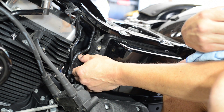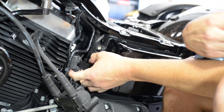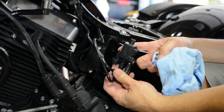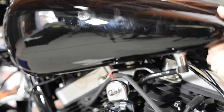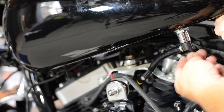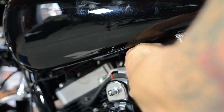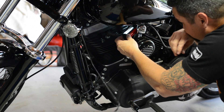If you've come this far, you've now removed all points where the vapor canister and its associated hoses attach to the bike. The last thing to do is remove the hoses and the canister itself. Make life easy on yourself — remove the bolt on the rear tank mount and loosen up the bolt on the front tank mount so that you can swivel the tank up and down and get underneath it easily.